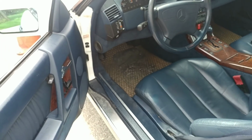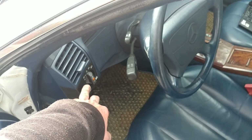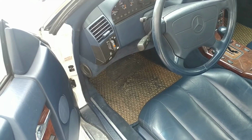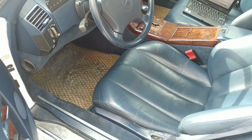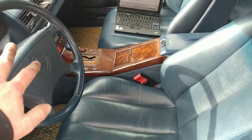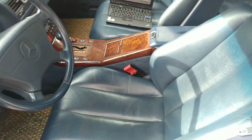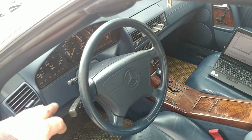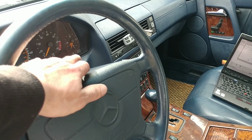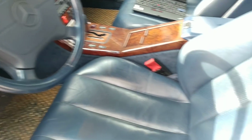The headlight switch was also replaced because it was very, very loose. You can catch fire because of that, because that circuit is not fused. And that's that. In terms of the climate control, that dial, you can live with that if you want. That can be fixed, but it's not critical. Now we have oil pressure, and because one of the diagnostic modules was missing, the check engine light never came on. Now it comes on, goes out, no codes, which is fine.